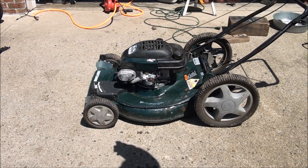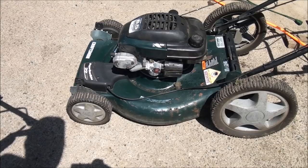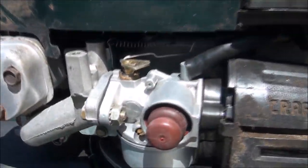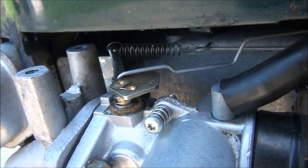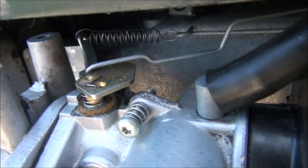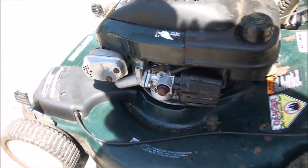What I was doing there is adjusting the governor spring. There's a little bracket that the spring is attached to — I'll show you where. See where the spring is attached there to that bracket? Basically you just bend that bracket that way and it pulls the spring tighter, which revs it up more. Be cautious, because bending it a little bit revs it up a lot.